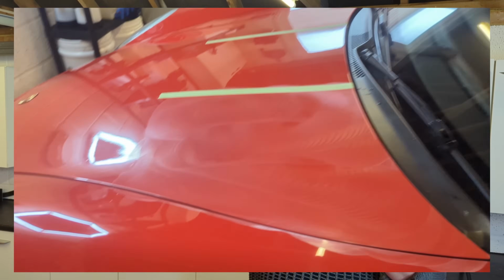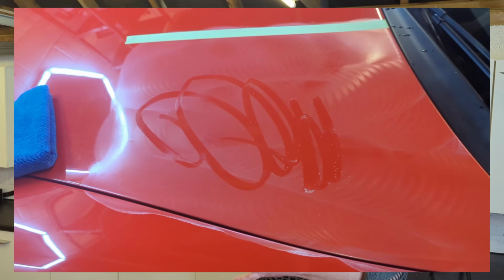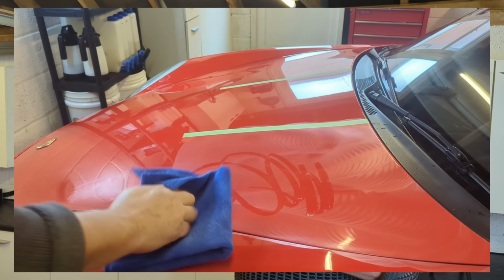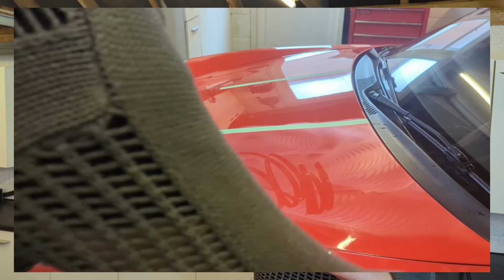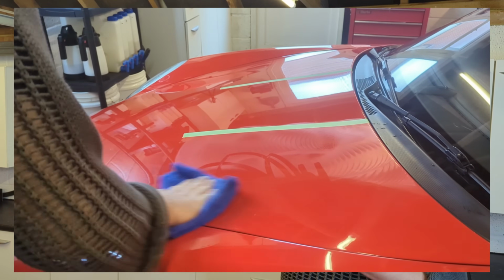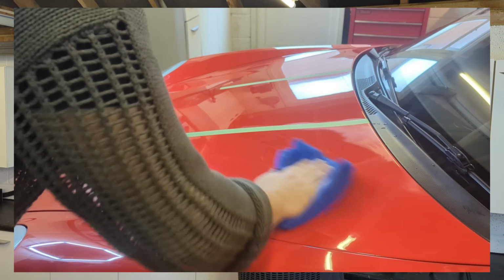These are generally the easiest to wipe off the panel. The disadvantage is they're not really going to dig out swirls, only the very fine stuff that's machine induced. So you get the idea. Sometimes this can be the most suitable product to use as a single option if the paintwork isn't full of defects and you just want to gloss it up. So you're going to remove less material than either of these products, but in particular the cutting compound, okay?